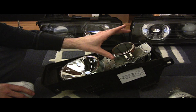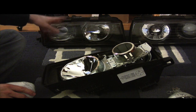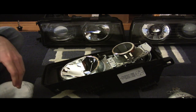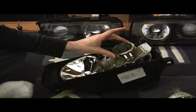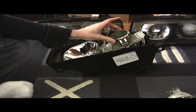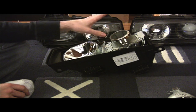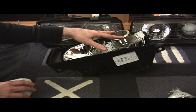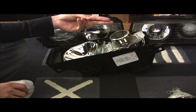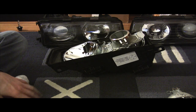Retrofitting is world's better than the output you get from running plug and play kits in these lights, and definitely world's better than the output with stock headlights. But it takes a little bit of time, a little bit of effort, and a lot of reading in order to know how to do this. In terms of running the electronics with these, there are ballasts available — digital ones or regular analog ballasts — that will plug directly into your stock lighting. You run the risk of wiring damage and OBC failure codes, but there are workarounds.